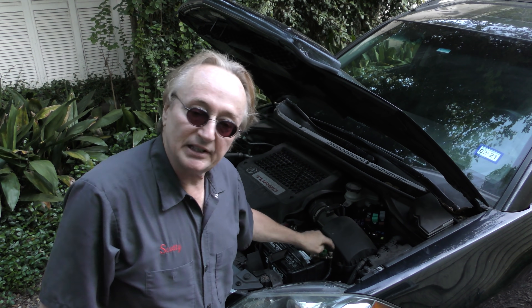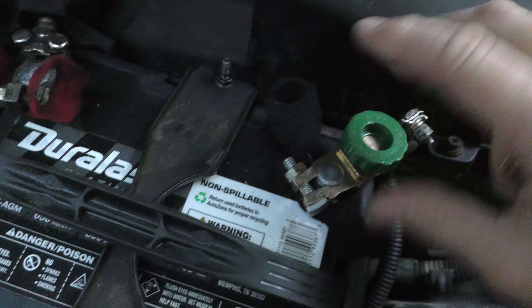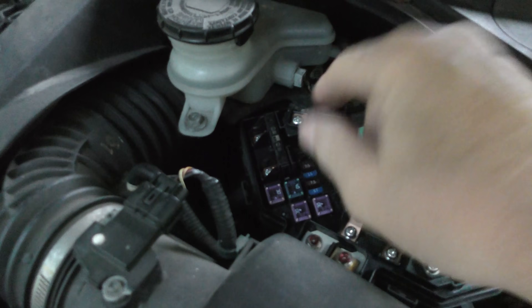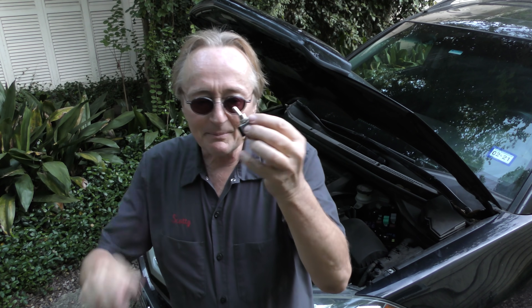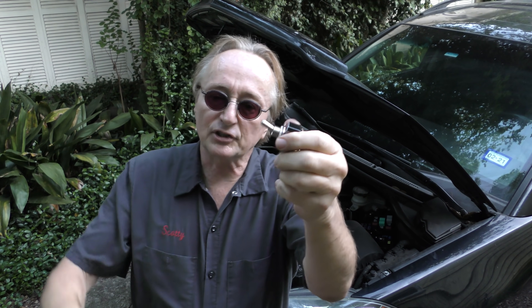Using a toggle switch, some wire, and a fuse. He had been disconnecting the battery cable — he's got one of those battery cable disconnects that just unscrews — but that's kind of a pain. You can pull that number 23 fuse out when he stops the car and put it back in, but that's a pain too. So I'm going to hook a switch up to that fuse and rewire it, so that when he's driving the car he just flips the switch on, and when he shuts it off he has to remember to turn it off, then it won't drain the battery.